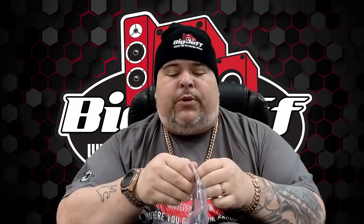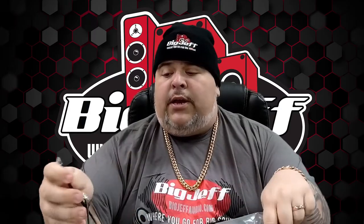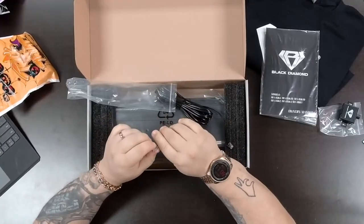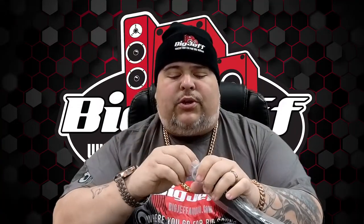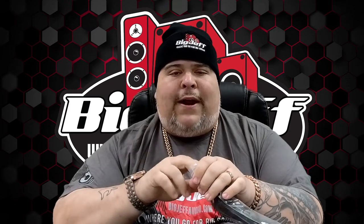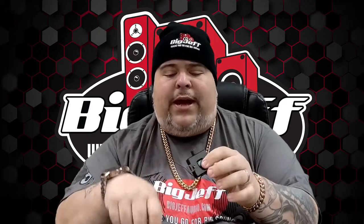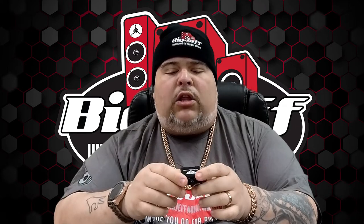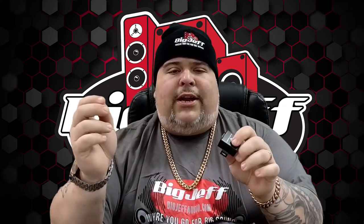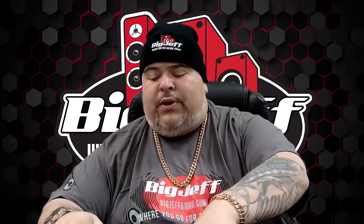Keep in mind on a lot of bass knobs and wires you have to use the correct one. We get it all the time — people order one from a Massive Audio or elsewhere and it doesn't work. It's all about resistance; it can actually injure or damage your amplifier. Here you get a pretty decently long cord — it should be able to reach from the back to the front. Please use this cord. These do match up with the amplifiers, so don't think you can just plug in one from another brand unless it's a universal style using RCAs.